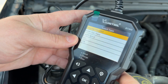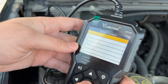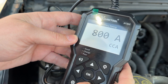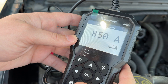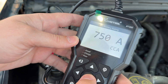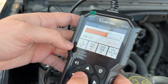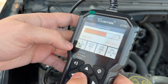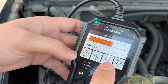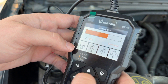Alright, went ahead and checked the surface charge. This one is an AGM flat plate, cold cranking amps should be 760 — but it only goes up in increments of 50, so we're testing at 750. It says please check connection, testing, please wait. The result: charge state of health 65%, 12.61 volts, 750 rated CCA, and 492 actual CCA. It's saying to charge over here and to replace — that's interesting.